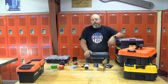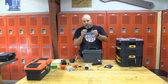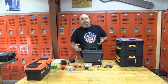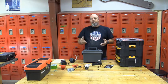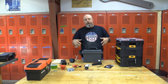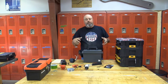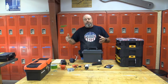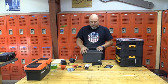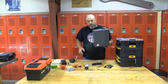Obviously you can disconnect the battery. The other unique thing we're going to do is add these battery terminals — or jumper terminals as they're sometimes called — because a lot of times when we're rewiring a trailer from scratch, we don't have the trailer plug installed. We're just trying to check a leg of the wires, a particular light, make sure we don't have a short before we move on to the next section. It helps us pre-troubleshoot any issues on a brand-new trailer. This is the most common approach in DIY builds, so we're going to follow suit.